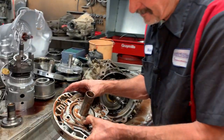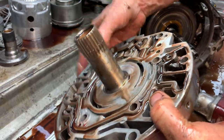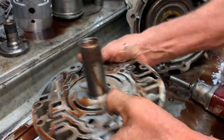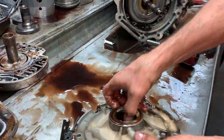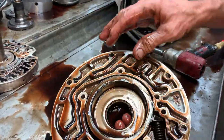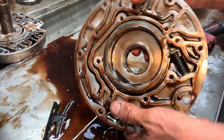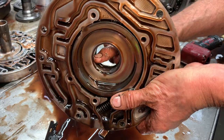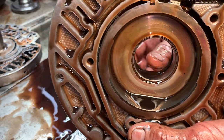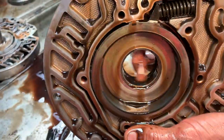Stator looks good here. You do see a little bit of wear starting to get right here. Body's good - we'll press another stator in here. Stator body is really good. All this stuff in here will be replaced - we have a kit that we put in every one. The old bushing's getting a little thin on one side. See how it's never touched there - still has the teflon coating on the bushing right there - and then you come over here to this side and it's worn.